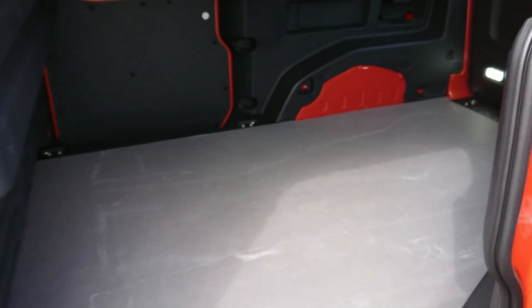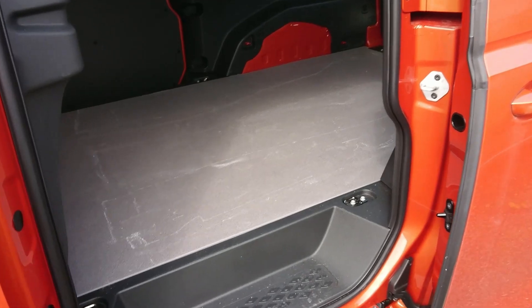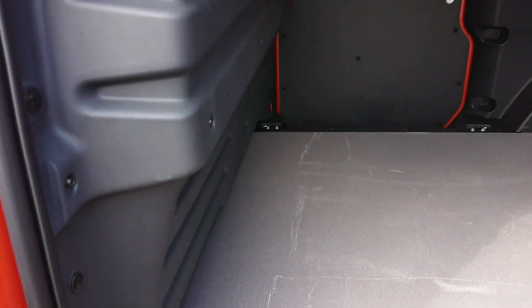I want to show you how to fit a seat in the back of there. A lot of people step away from these vehicles because they are electric, and normally speaking I would step away from them, even though I'm experienced fitting van seats. What I do know — because I've seen a video from the customer Martin Knight, thank you for letting me work on your van today — is he showed me a video where there's an inverted subframe on the front half and then your battery package, your conventional kind of van floor. So I know between the two seat pucks there's some structure, and on the video it looked like a captive nut, so I'm fairly convinced I can get my rear seat mounts onto something structural and then bridge and grab hold of that inverted subframe.